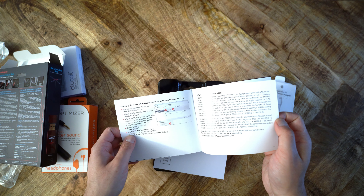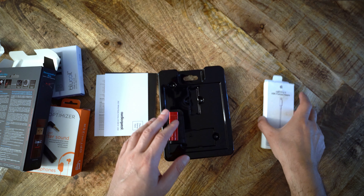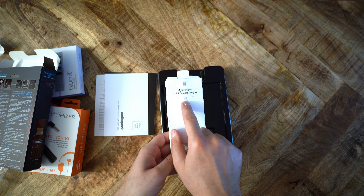The Dragonfly Red is surprisingly heavy. It's made of metal, and on one side is a 3.5mm jack, and on the other side, when you pull the cap off, is a regular USB-A tip. You just plug this thing into your computer and it should recognize it. For Mac computers it'll just show up, though Windows sometimes requires drivers. If you're going to use this with an Apple mobile device like an iPhone, you're going to need the Lightning to camera adapter — that specific adapter; no other adapter will work. When you have all this stuff sticking out of your pocket it looks really weird, but unfortunately this is the way Apple has decided to have third-party manufacturers use their Lightning port.